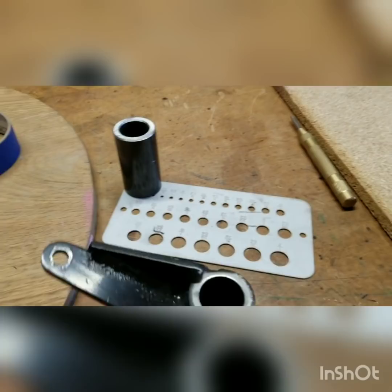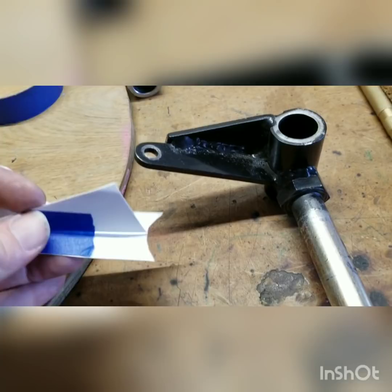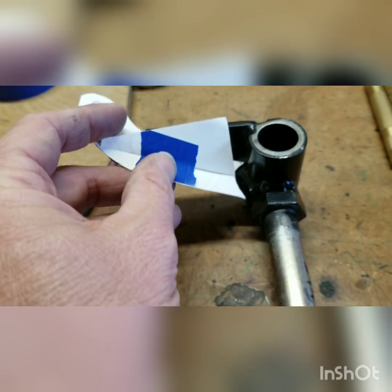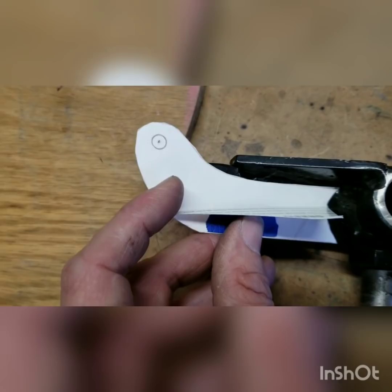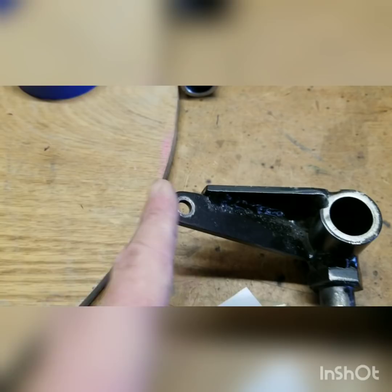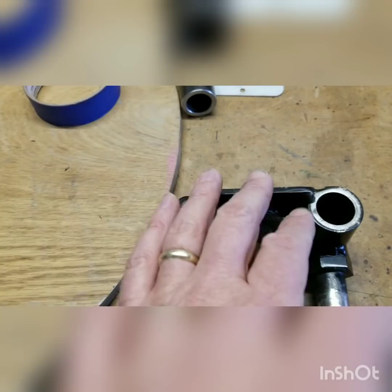So here's the Azusa part, and here's this piece which is going to replace it. I could have cut this apart, but this is a perfectly good spindle and I didn't want to cut it apart and redo it. So that's going to replace this — see where it moves it over? Just moving it over an inch in that direction. Once I put it in, it's not really going to move the point out further. If we go too far out, this is going to have more travel than your Pittman arms, so you'd have to lengthen your Pittman arms if you want more travel. But this setup works great with the Pittman arms — it bottoms out with the Pittman arms just about the time this hits the bracket.